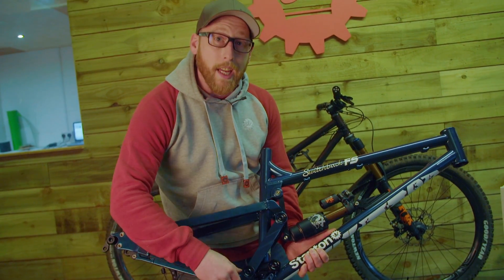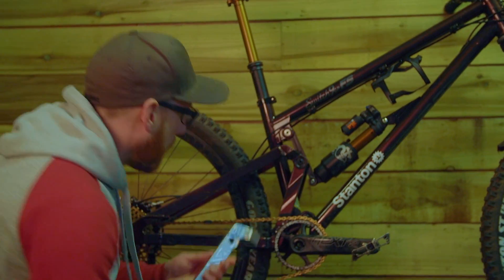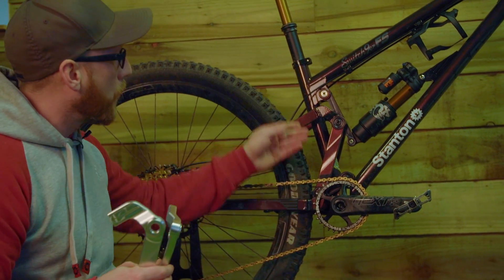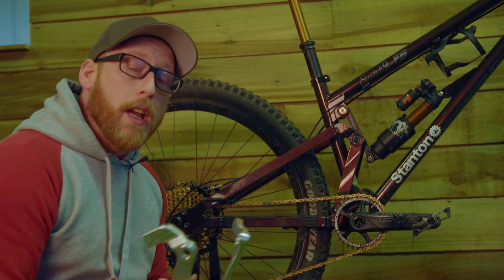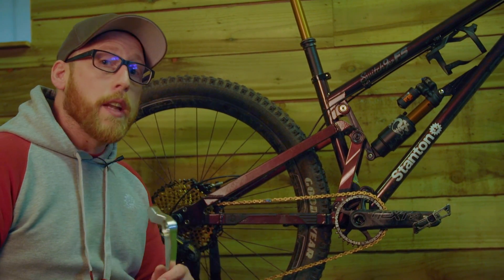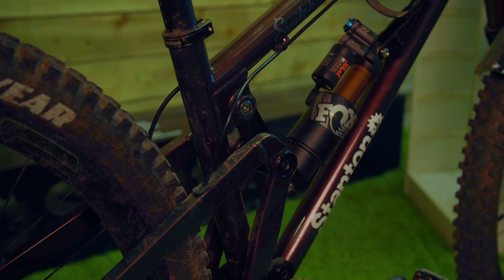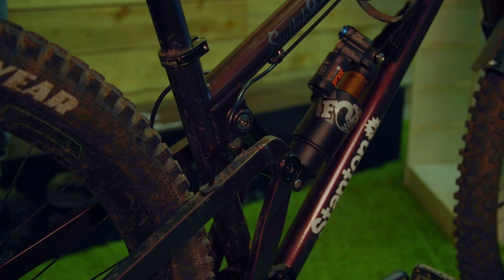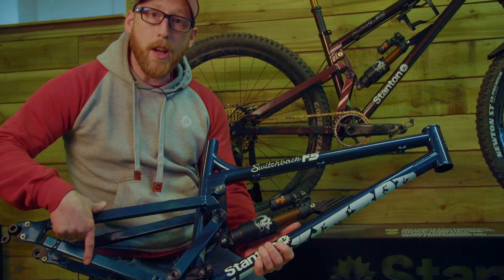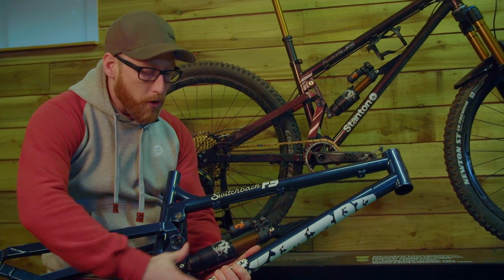This is then attached to what we call the dog leg — we have two of these, CNC'd from one piece of aluminium each, positioned either side to brace all lateral flex out of the seat tube. You might think lateral flex is good for cornering, and I do agree with that, but I don't think it should be through the whole assembly where the suspension linkage is working. We also don't want lateral movement pressing into the shock and creating stiction. So we vary wall thickness in these sections to allow flex for cornering, but not within the drive assembly.